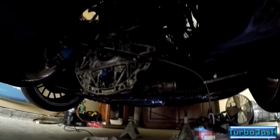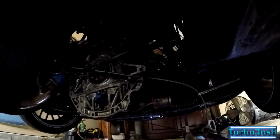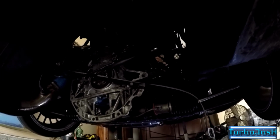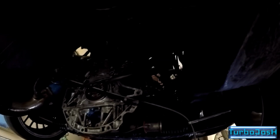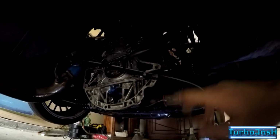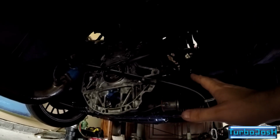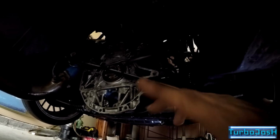Not to mention the starter problem we had. Spec sent me back the wrong flywheel, and then pretty much just robbed me of other stuff. I sent my flywheel to Spec to be resurfaced because it was their lightweight flywheel, and they sent me back the wrong one, I guess by accident. Not mine, somebody else's. It had too many teeth, so I had a starter bind situation. Wouldn't start the car. I had to pull it out, situate that first. Then we found out about the leak, then we pulled it, thought we fixed it, which I redid the seal.